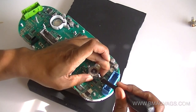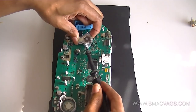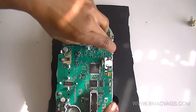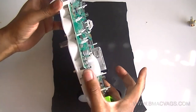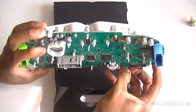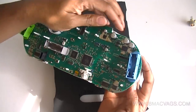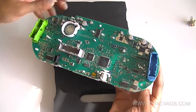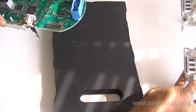So we're just replacing those — same on the other side. The wider the screwdriver, the better and easier it's going to be to remove. We're just breaking it down slowly, making sure we aren't leaning on the printed circuit board too much, because we don't want to damage any traces. The immobiliser's there — we don't want to short anything. Just take your time and remove it. Try not to break anything and be very careful, because this is a 15- to 16-year-old item. You can just see me pressing on those tabs to make sure they're giving clearance, and then you'll just be able to slide it apart. It'll just come apart.